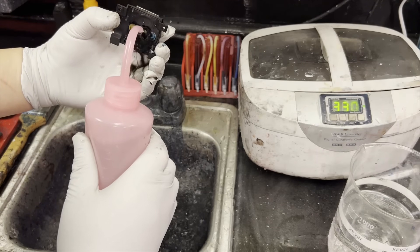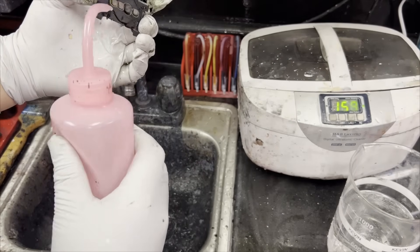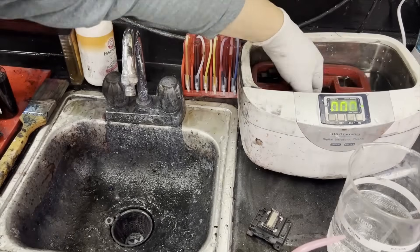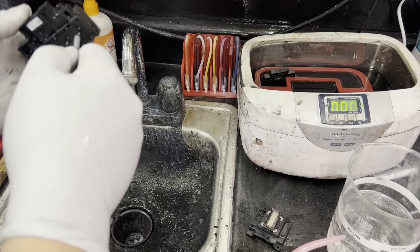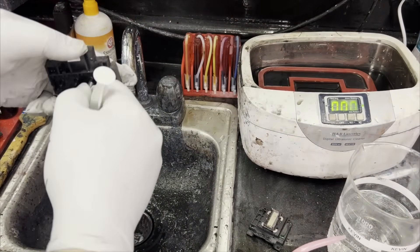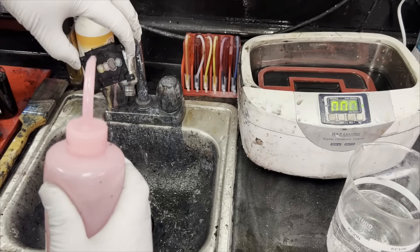Now we use a scrub bottle and gently clean the mesh. You're going to clean it until there's no more ink coming out. For the second one, make sure the cable points to the sky. And the third one. The black one is the one with a sponge on the sponge side. Or if your sponge fell off, it's the label side — the serial number side — to your left, and the sponge side is up. After a while you might see more ink coming out.